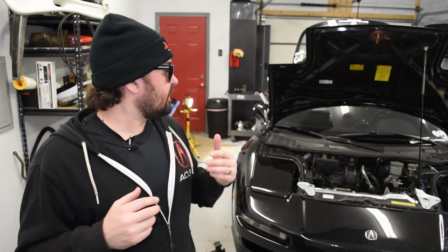In that valve adjustment, just as a piece of trivia, I think only about a third of them were any kind of out of spec. Nothing was way out of spec. I would guess that the furthest anything was off was probably a single thousandth of an inch. And granted, the range of adjustment is only like 2 or 3 thousandths of an inch. But there were a handful that were a little bit tight, and I think only one valve that was a little bit loose. But all of them came into spec just fine, so all of them should be identical with their either intake or exhaust brethren at this point.